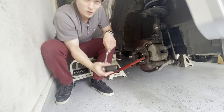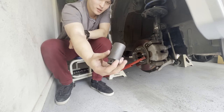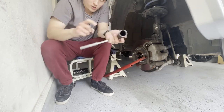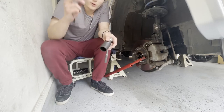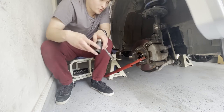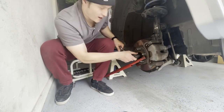Just a heads up: you will need a 12-point 30-millimeter socket to get the job done — use a half-inch drive. When I took my Integra apart I broke like two 3/8-inch breaker bars taking the axle nut off because I just didn't learn my lesson. Use a half-inch.